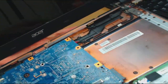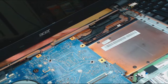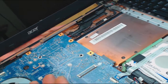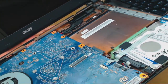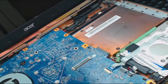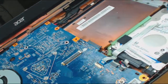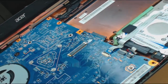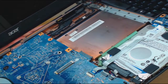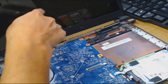Here's the hard drive — I have to do data recovery for this customer, but that's for another video. This video is only about the keyboard. So you would either reconnect everything and sometimes this works — keyboards and mouse pads can be flaky — or if you've concluded it's not the OS and not the drivers, you go to the hardware, disconnect the ribbon cables and reconnect them. Be careful of the screen when you lay the laptop down.